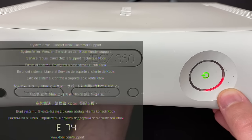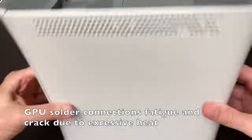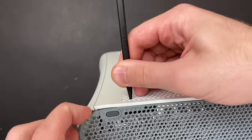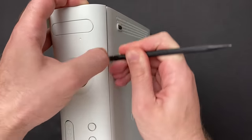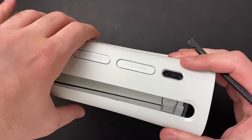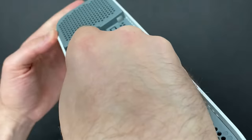This is a very well documented issue with the original Xbox 360. It requires re-balling or re-flowing the GPU. I'm not running a repair shop with any specialized equipment, so I'm going to be re-flowing the GPU with the tools that I have. But I think I can do a little bit better than some of the tutorials I've seen. There seems to be consensus that most of the home remedies to resolve this issue are only temporary fixes — none of them are permanent.